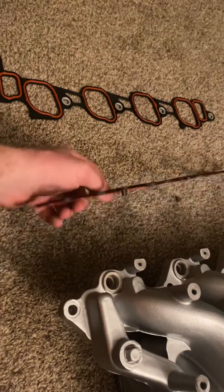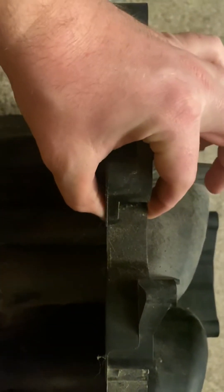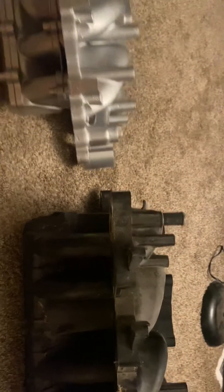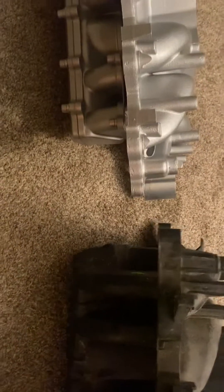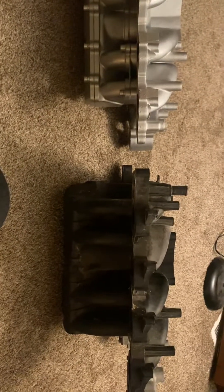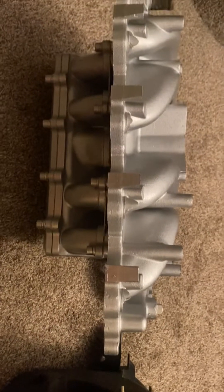Your factory gaskets should work as well — these are Fel-Pro, which is what I always run when I can't get factory. Another thing you'll need to figure out is the flange. Look at how thick the flange is on the stock intake versus this one — chunky versus thin. As a result, your stock manifold bolts will not work; they're going to be too long. When you tilt the intakes on their sides the differences in runner length are also much more noticeable.